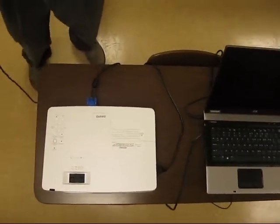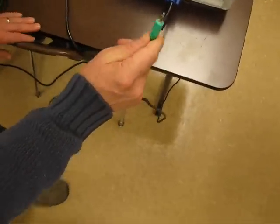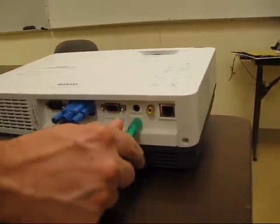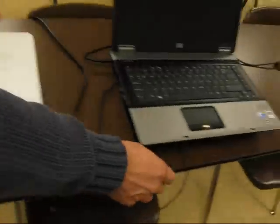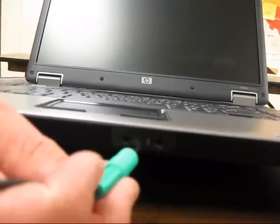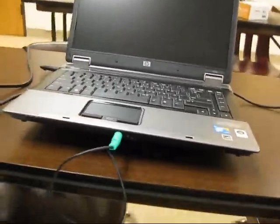Now we go to the next part. In order to connect sound, we will also have another cable. The cable may or may not have a green color on it. It gets plugged into the projector where it says 'Audio In'. We also have to connect it to the computer. On the other end, on this particular computer, it's up front — it's often on the side. We're going to plug it into the plug with the headphones picture, not the microphone, but the headphones. And that's all we need for sound.